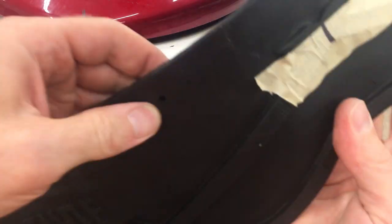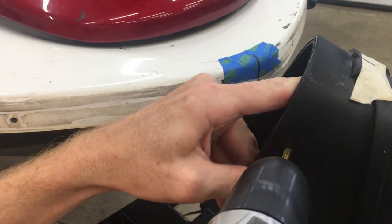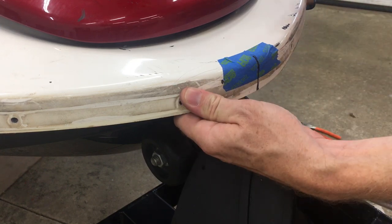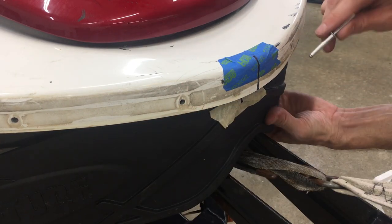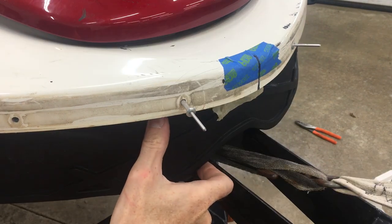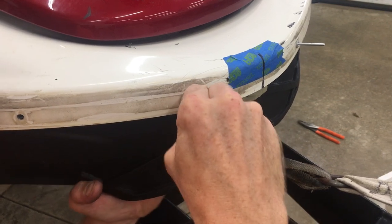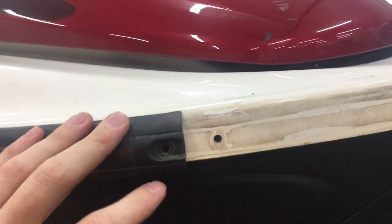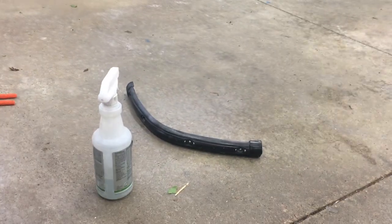I need to enlarge these holes a little bit for the rivets to fit through. Now I don't need the double-sided tape anymore — I want the shield to sit 100% flush against the back of this lip on the hull. I can use two rivets to hold it in place for now. That works better than the tape, to be honest. I can't fully attach it yet though, because these rivets also need to go through the bumper trim piece. Now that's in place — this one I can go ahead and install, but this one I can't yet because it too mounts through the front bumper trim piece. So I can get these three done.